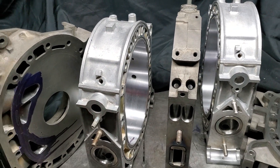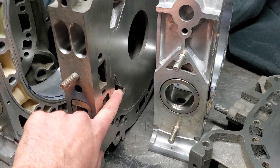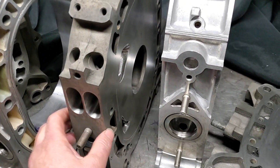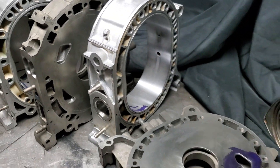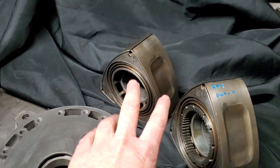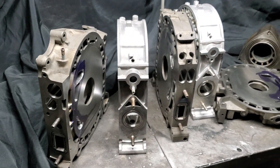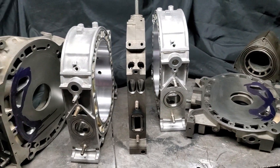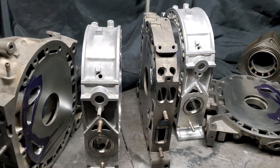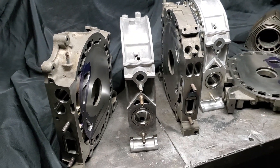Resurfacing came out all right on all the sides. This one had some heat damage — it was actually shrunk here at the exhaust port — but we were able to recover it. That's one of the nice things about lapping. Next up we'll be doing rotor work and getting our balancing done, getting one step closer to the build. I really appreciate everybody following the channel — we just passed 6,000 subscribers, which was amazing — and I really appreciate everybody commenting.